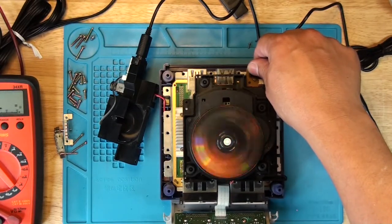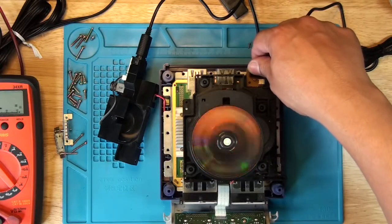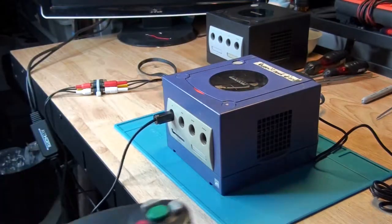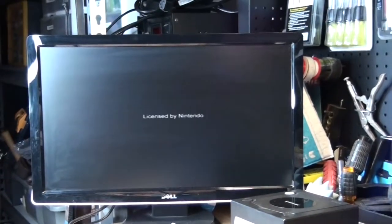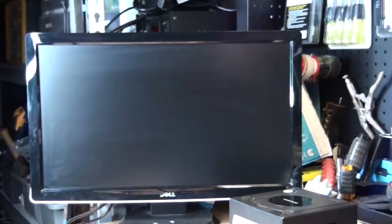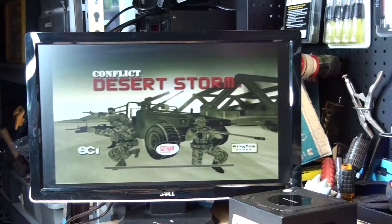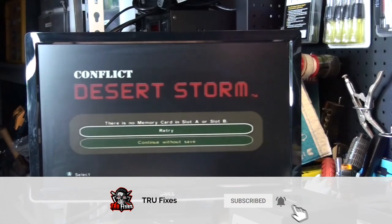Okay, yeah — there we go. It's spinning. I'm going to put it back together and hook it up to the monitor to confirm it actually works, but from what I can tell it's already reading. Put the game in and go to the monitor. So far so good — I can hear the disc spinning. The disc is working. We were able to fix two GameCubes that were having issues with the laser by adjusting the potentiometer and making sure it fell between 200 and 500 ohms — they were both a little bit off. The best way to do this is obviously by using a meter, and that cuts a lot of the guesswork out. Alright guys and gals, we have two working GameCubes and we're back in business. See you in the next video!